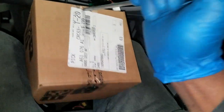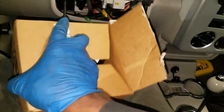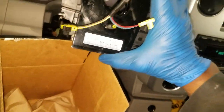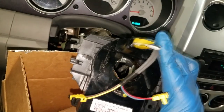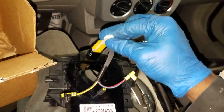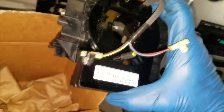Let's take a look at the new clock spring. This is OEM — I have no idea if they even sell aftermarket clock springs; it's the only kind I've put on over all the years I've been doing this. Same thing as the old one. The installation procedure is merely a reversal of the removal. Now, make sure your steering wheel is straight before you start removing it — I probably should have mentioned that earlier — because this clock spring is centered from the factory. They even put a little tab in here so you would know.